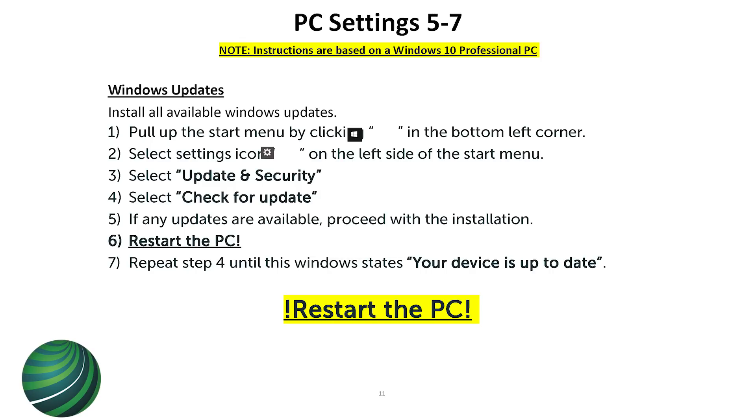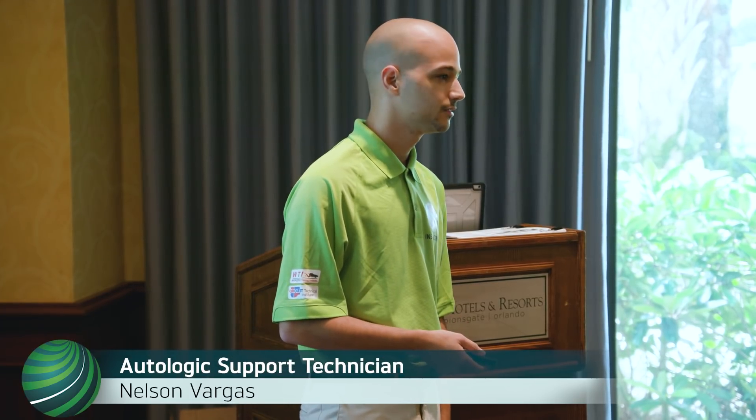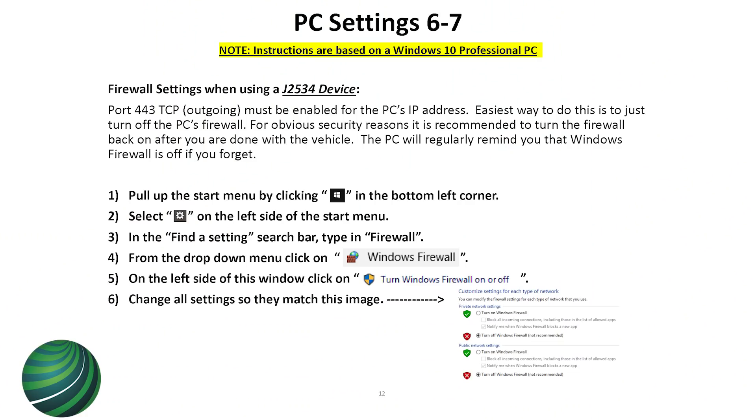This is how to run your Windows updates before you install ISTA — you want all updates up to date so they don't trigger during programming. Get your computer fully updated, then turn updates off afterward. Also, one thing I've seen many times: people call me saying they did everything right, I look through it and everything looks correct, and I ask 'have you restarted the computer?' No. Restart it — two minutes later everything works.